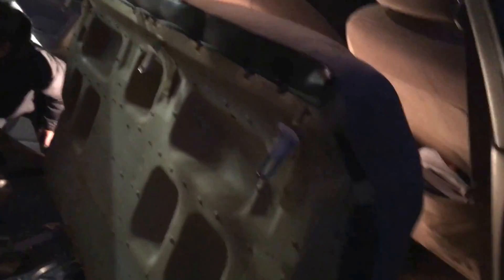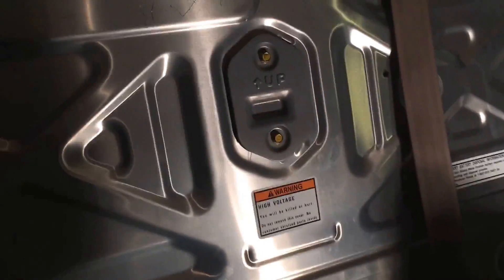One of the tricks to getting the seat off: after you get the bolts taken off from the bottom, you're gonna lift up on the whole seat assembly. There are little hooks that fall back into these little hook enclosures right here — those slide into little slots in the frame of the car. You also have the seat belts and all other stuff in the way, so you're gonna have to pull those up out of the way and drag the rear seat outward from there.